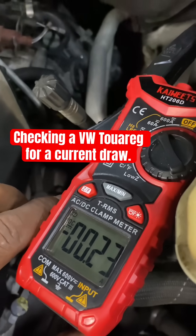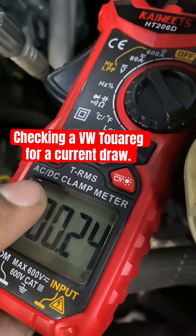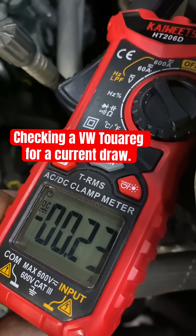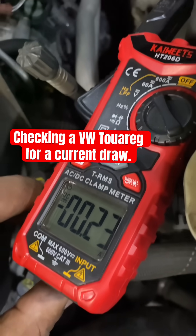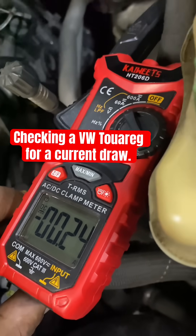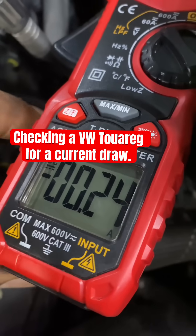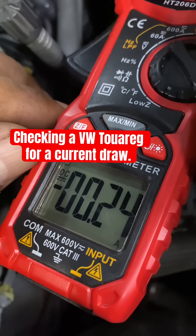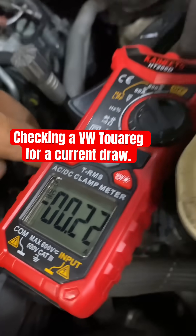...around 60 to 70 milliamps. This is hundreds — you want another zero. If it was 0.023 I'd take that, but this is hundreds of an amp. If you park the car and leave it for a few days, the battery's gonna die. So right now we're just checking what's killing the battery. That number should be much lower — it's gotta be like around 0.0-something. Let's see what's going on.